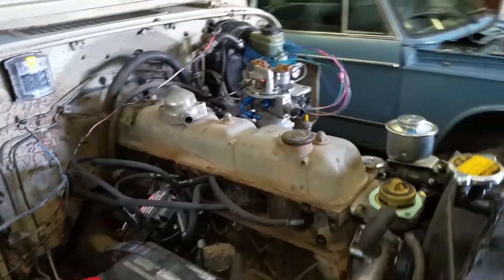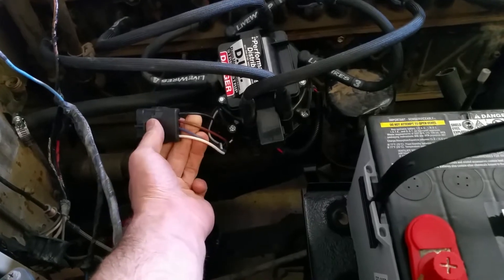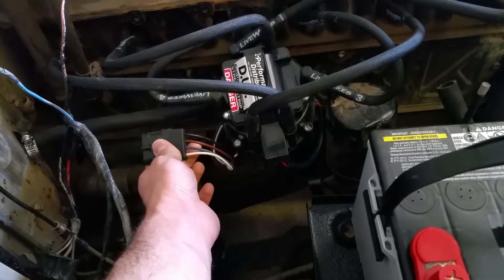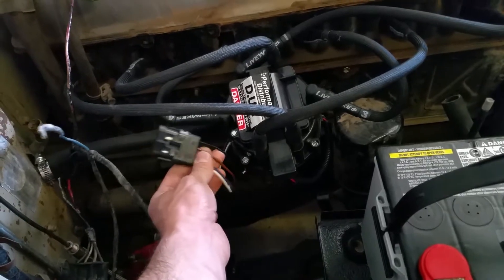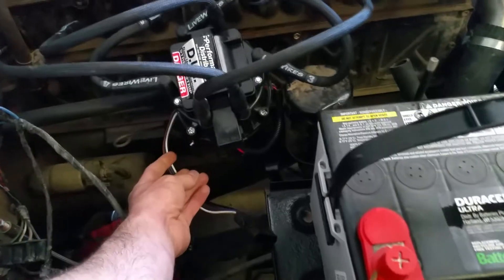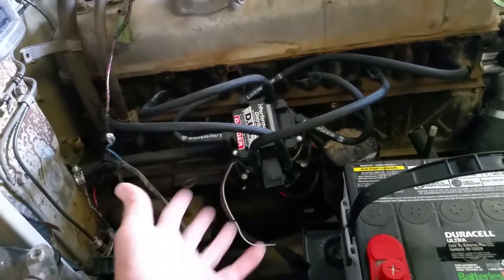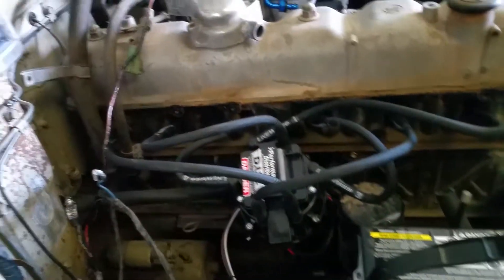So we're going to go from there to a fuel pump — that Walbro. First the fuel filter, then the fuel pump, then it'll just run up on those rails up to the top. And we've got an HEI ignition from the DUI guys — they built this up one. And then for the MegaSquirt, we put on this four-pin adapter that has your five-volt, your ground, and the ignition signal. It's got the four-out because we're going to be trying to control this with the MegaSquirt, because normally you'd have vacuum advance and just set your static timing, but we're going to control that with the MegaSquirt. So the plug is going to go up to the MegaSquirt.